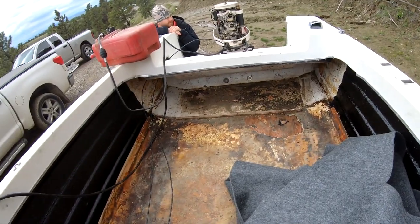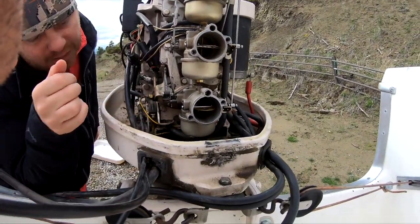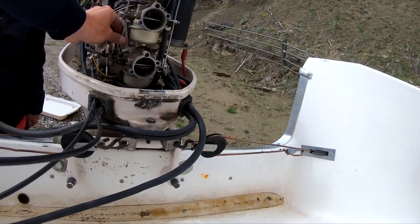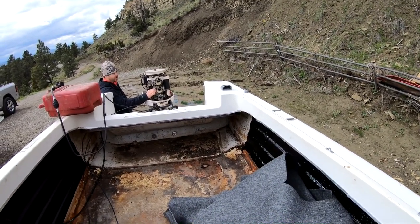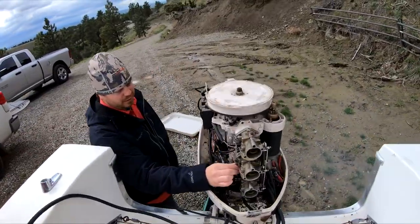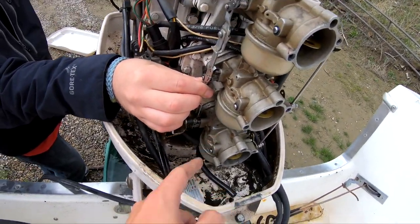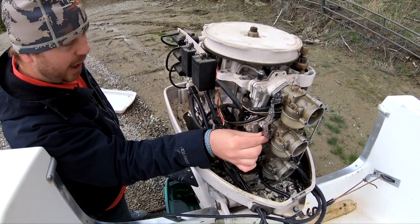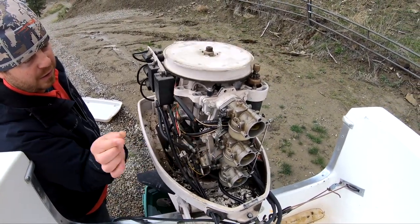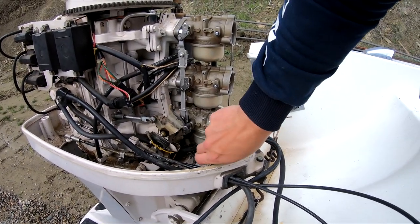Choke's working. You've got something leaking right here — see that? Yeah, maybe I just need to tighten that one a little more. Let me try to turn it on and see if you can get it to start. Well, she started! She sounds better than she did before. Let go, see if it dies. Yeah, I wonder why it was spitting — that bolt's leaking too, so maybe that's why. We'll be right back.